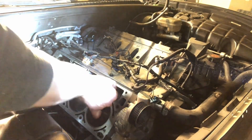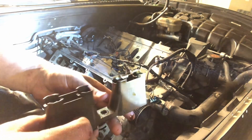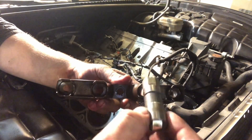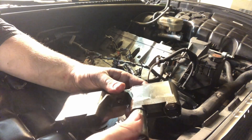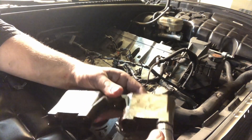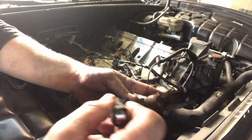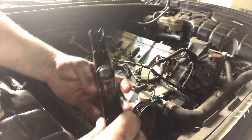I got this out and it didn't come out with any lifters. I just found the issue — I took one of these other lifters out and put it in here, and I can put it in there and spin it, where this one is not that way. So we lost a lifter guide, and that means we'll be replacing our camshaft.